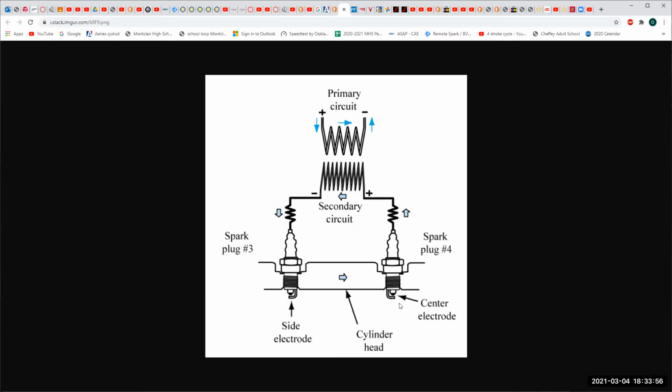but we weren't that good at running oxygen sensors or PCMs or anything like that yet. So throttle body injection was a transition between carburation, which was a purely mechanical system, and the port fuel injection that we wanted, where we can control fuel flow into each individual cylinder. And it bought us some time, basically.